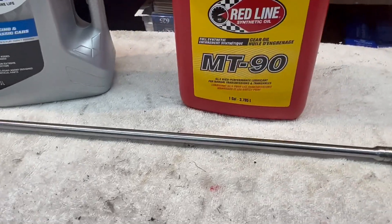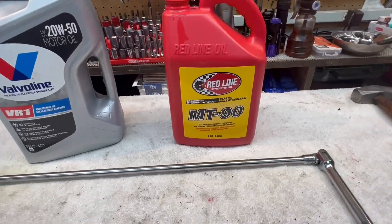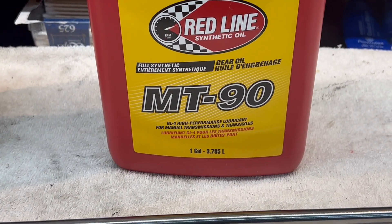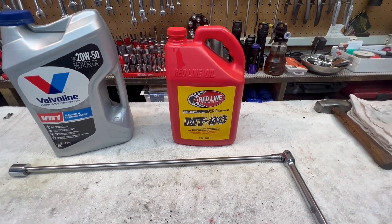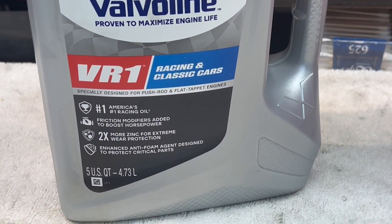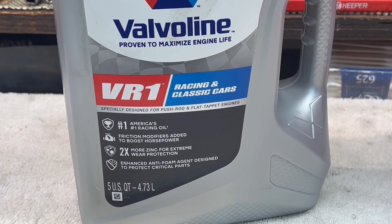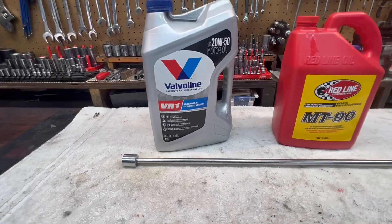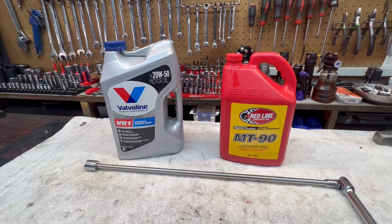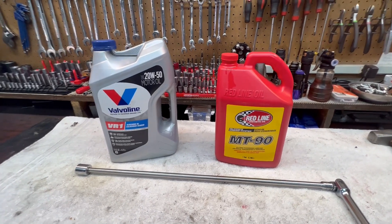What I do is make life a little easier — coming over here to the bench. I use a nice big breaker bar with a really long extension and the necessary socket. This is the oil I'm going to put into the transmission: MT90. It has the necessary additives to handle gearboxes that use brass bushings rather than needle bearings like the new ones do. And I use Valvoline VR1 oil in the engine because it has the necessary additives designed for engines that have flat tappets and brass/bronze bushings. These two oils have everything necessary for our old bikes, unlike new oils that don't include those additives.